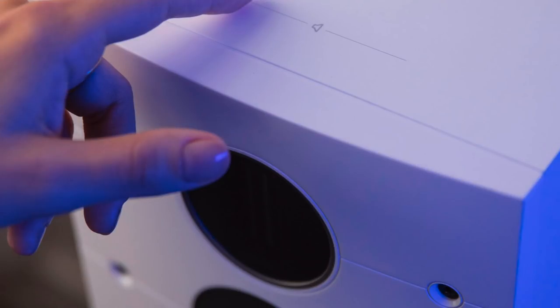DALI speakers, including the Callisto's, are designed with the front panel parallel to the wall — no toe-in or toe-out. Without a Sound Hub, simply connect the analogue outputs of your source to the RCA inputs on the rear. Volume is adjusted by moving your finger over a sensitive track on top of one loudspeaker, indicated by a row of LEDs along the front. If the speakers are unused for 30 minutes, they switch to standby automatically.